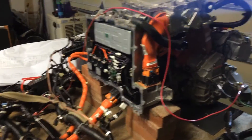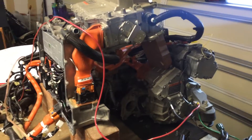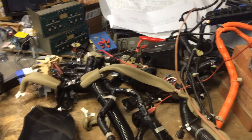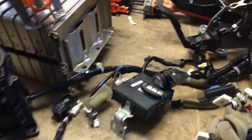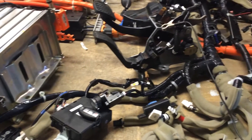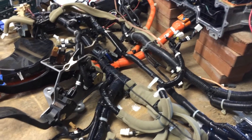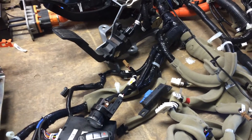After that, the battery itself, the charger, the DC junction box, and probably even the inverter and motor could technically all be from a different vehicle. That probably goes for the IPDM, the fuse box, the dash display, and the shift controller as well — those could all be sourced from different vehicles. But the main three things are the BCM, the VCM, and the LBC, as well as the key. Having those all from the same vehicle certainly makes life a whole lot easier.